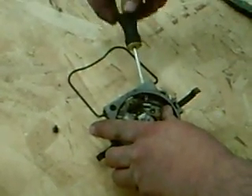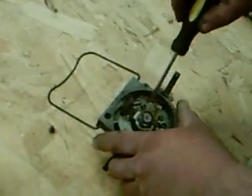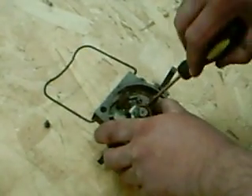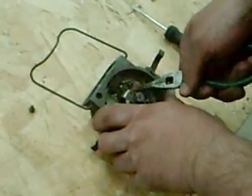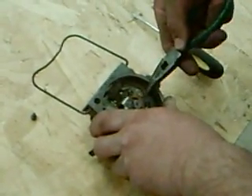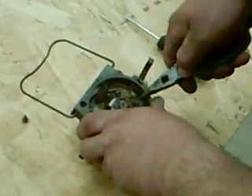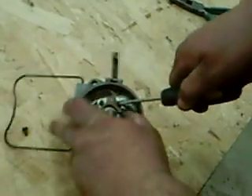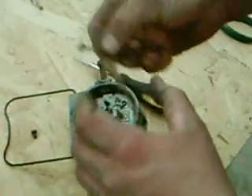There is the screw here at the top of the points. It holds the metal bands from the breaker point assembly to the part that's mounted to the actual breaker housing — the stator plate. And a little cotter key, which we have to use small pliers to squeeze together to pull it out of the way. Sometimes these things can be difficult, other times much easier. Tonight, of course, because I'm doing this, it's much more difficult than normal. Now I can just pry this piece out of the distributor off of a peg that it's just sitting on.